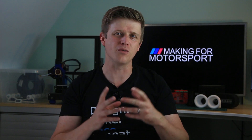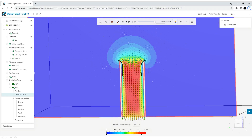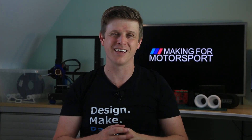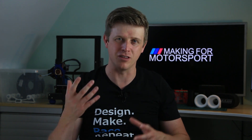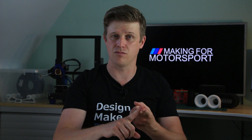That fast-moving air looks a lot like a flared air horn, but it's also narrower than the actual inlet tract. So if you don't give your incoming air a radius to follow, it's going to make its own, and in doing so it narrows the cross-sectional area available to flow — and that is going to cost you airflow, which is going to cost you horsepower. In individual throttle bodies, velocity stacks are a key part of the inlet track: the port in the head, the runner of the manifold, the throttle body itself, and the velocity stack.